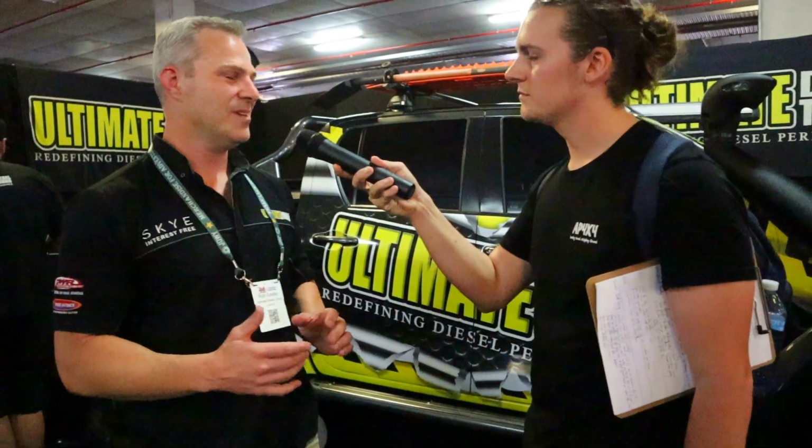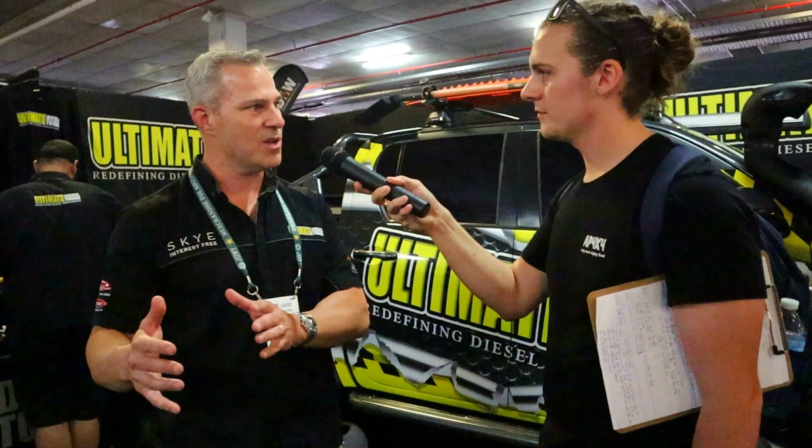Look, it's not about ridiculing anyone about how they tune or what they do, but it's about making sure the process is right. So diagnosing boost leaks, turbos, the VNTs not working right, injectors having issues, all these sorts of things that people think, oh, maybe just getting a tune will help. But as I said, that potentially amplifies the mechanical issues you've got, and then we see other issues down the track. So it's really important to check those issues and concerns before you go tuning your vehicle.